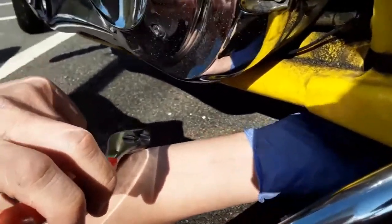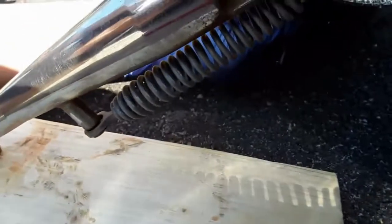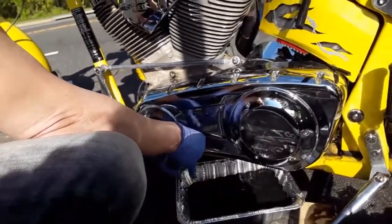I've tried to get a socket up there to no avail — I have to use my camera to see where the bolt is from the bottom. The easiest thing to get in there is a regular handheld Allen, but sometimes it's too tight. The trick I use is just to use a plier for the initial couple turns to get extra leverage. Once it's turning, I finish off by hand. We finally got her out — we're going to let her drain and take off the inspection cover.